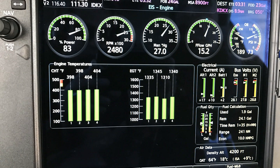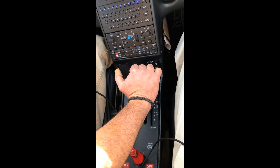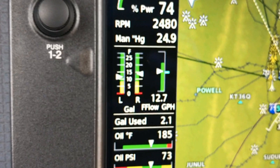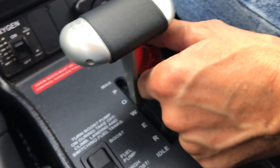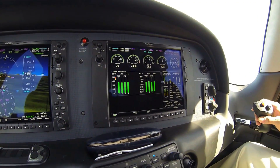From an operations perspective, the engine is really easy to operate. The engine page shows you all of the cylinder head temperatures, exhaust gas temperatures, fuel flows, and everything. From a leaning perspective, you take off and climb with full rich mixture and full forward throttle. When you get up to cruise — very much like the SR-22T — there's a fuel optimization caret. You bring the throttle back to about 2,500 RPM and simply pull the mixture lever back until the pointer reaches that fuel optimization caret, giving you ideal best-economy fuel flow without having to go through the whole lean-assist procedure.